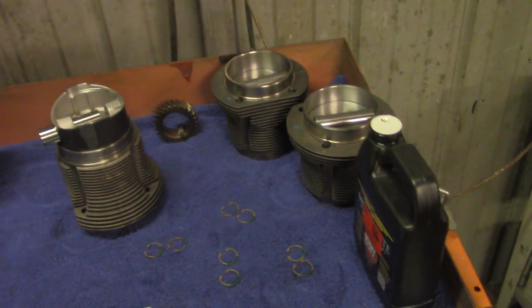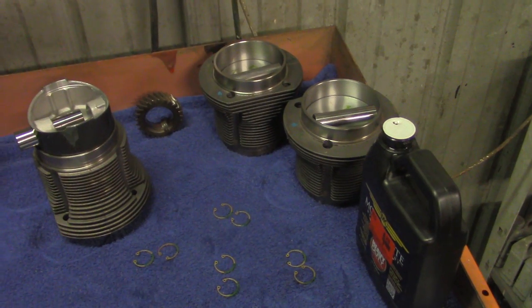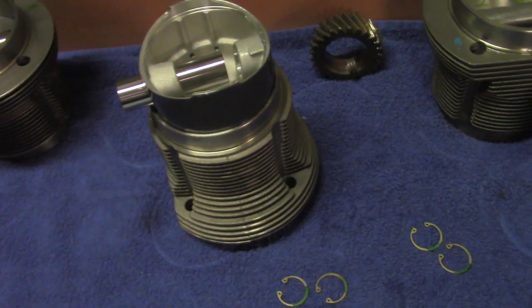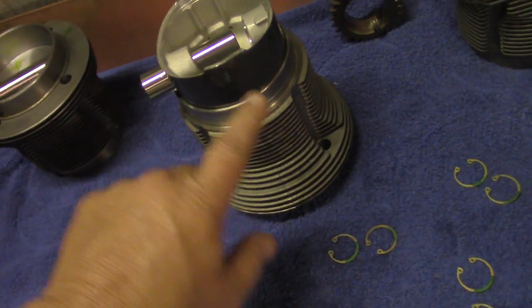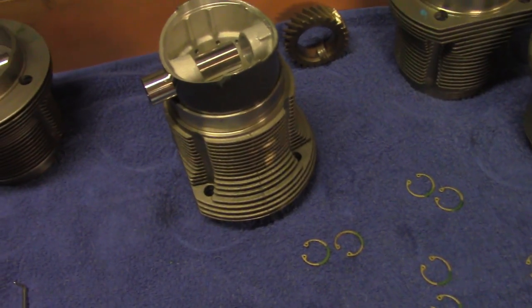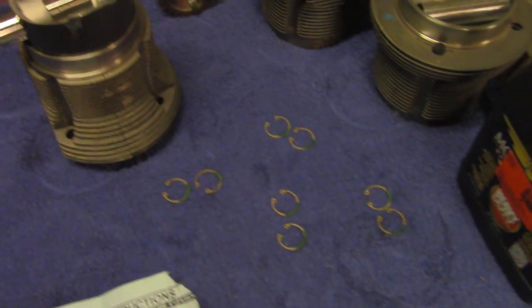So let's go over a few things. We're getting ready to put our piston cylinders and cylinder heads on. We're refitting the pistons into the cylinders — we set our ring gap, we pin-fitted our pistons, and we have them installed back into the barrels. The way I do it, I don't like to put the piston on the rod and then get the ring compressor in around the studs — it gets tight with a short rod to get the ring compressor out. I find myself scraping all the coating off the piston. So unless you have the pin moved all the way up into the oil ring, you can pull the piston out of the bottom of the jug. It makes it much easier if you pre-assemble the jugs and then put them onto the motor.